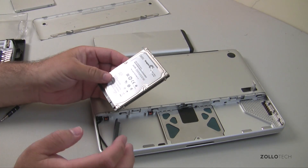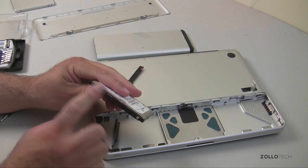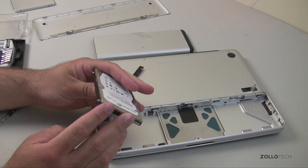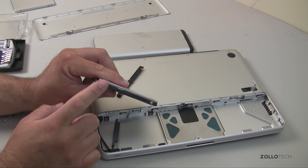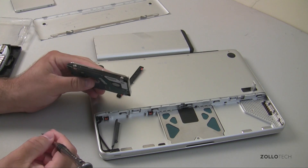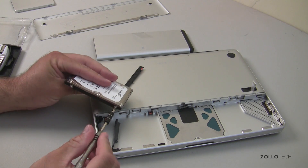That's pretty much it for removing the drive. Next you need to remove the little screws that hold the mounting bracket in place. These particular ones are Torx screws — you'll need the right Torx adapter, or you can use a pair of pliers to gently spin them out. We'll swap these from the old drive to the new drive. For those that are curious, this is a T6 size Torx.